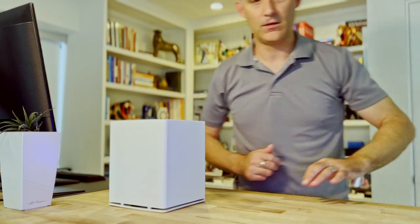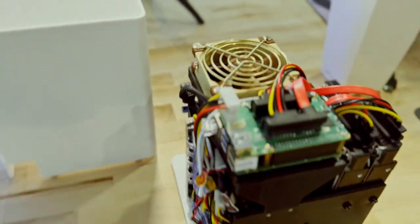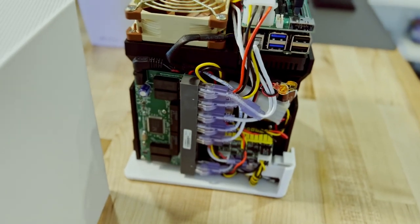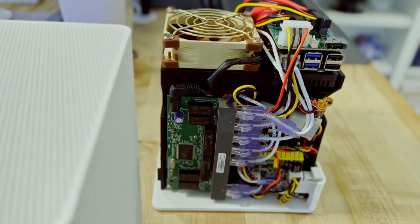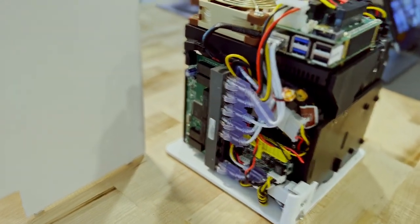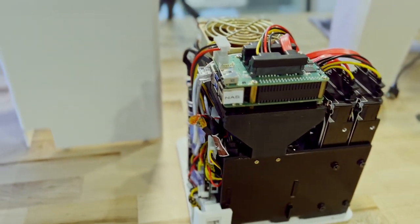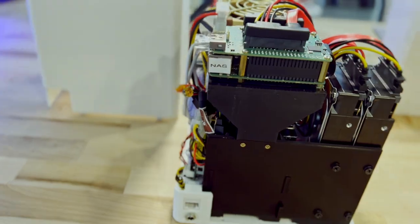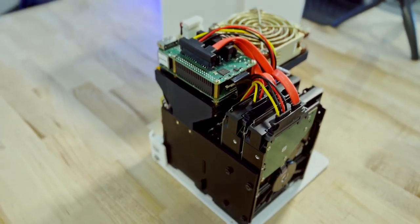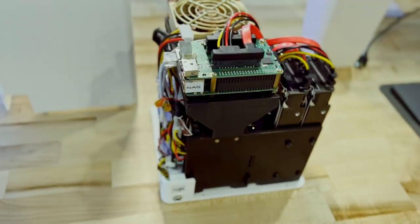Let's take a look under the hood. So under the hood, this is what the inside looks like — two hard disks that are mirrored on the outer edge. We have an eight-port switch that we've taken the housing off of to keep it nice and thin. We have a DC-to-DC power supply to provide power for the entire unit, and on the top is our fifth node which is for storage, and a pair of three-and-a-half inch disks providing our storage.